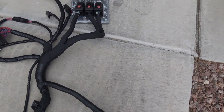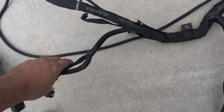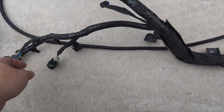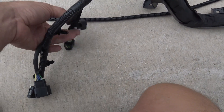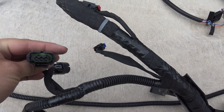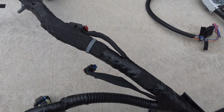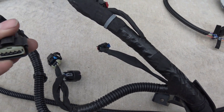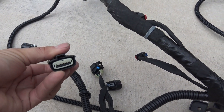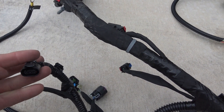So now we're going to come back up. This part goes over your water pump and bolts to the water pump. Then you have two branches — one that goes under your throttle body area and one that goes around your intake. For your throttle body area, this is your temperature sensor at the top of the water pump. This three-wire is your MAP sensor — it has a lock you gotta slide over. This is part of the DoD system, which controls your displacement on demand. Next to it is a three-pin sensor — this is oil pressure.